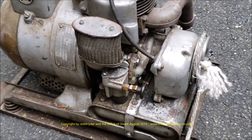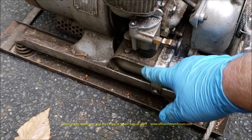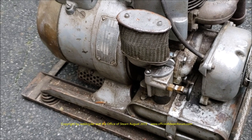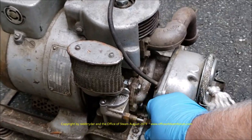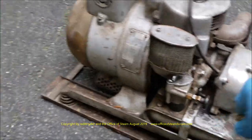It turned out to be one of the usual suspects — down in here there's a fuel pickup with a check ball, and the check ball was frozen, stuck to the base of it. So I popped the ball loose, cleaned it a little, put it back in, prime it a little bit, turn the fuel on, and it ought to run.